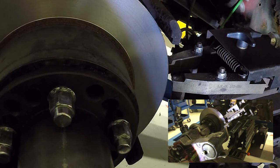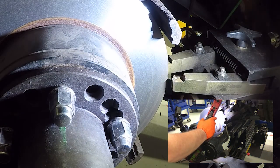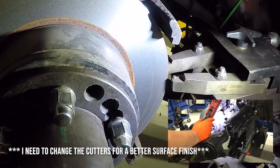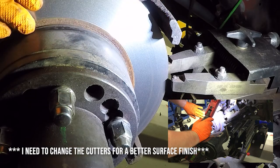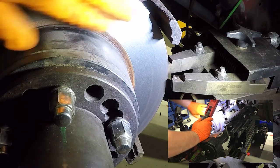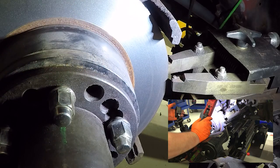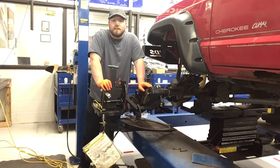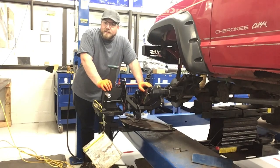You can turn the machine off and your finished surface is still a directional surface because those cutters are moving out like a record. So you want to take a piece of scotch brite, clean this up with some brake clean, and put a cross-directional, omni-directional pattern on it — just scrub all the way around to get rid of that record groove. Then spray down some brake clean, put your caliper back on torque to spec, put your wheel back on torque to spec, pump the brakes before you drive it, and you should be good to go. That's the basics of an on-car brake lathe. If you have any questions feel free to shoot me an email — be good and I'll see you next time.